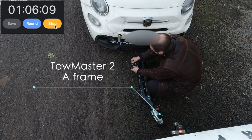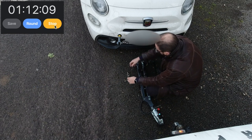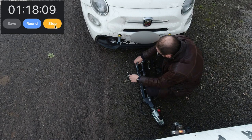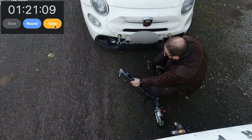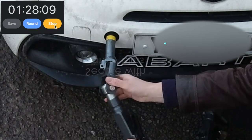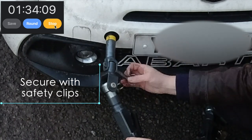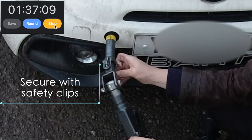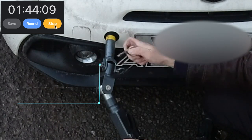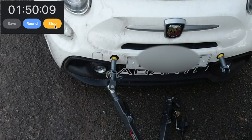You've got some safety pins with anti-loose devices so they don't come undone. Just remove those pins from your tow bar and then open it up and put the first of your brackets into position. Wriggle the pin through, then drop the safety pin on the other side - there's a flick-over ring that stops it from coming back out. All very easy, all very lightweight to do.